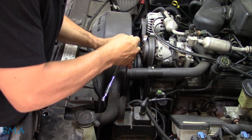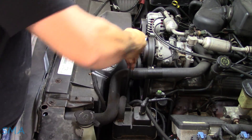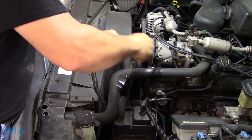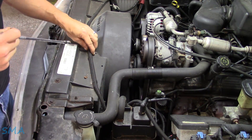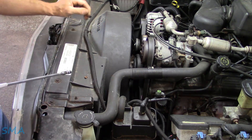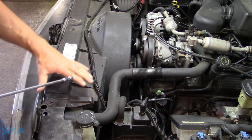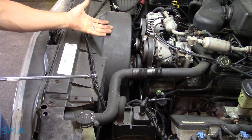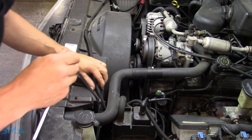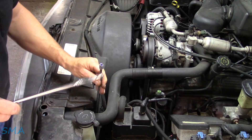We're going to see about getting this fan shroud off. The bolts are looking pretty crusty. I'm going to go through and get them all loose. We have two bolts down here on the side of the fan shroud, three across the top. We've got a battery cable here that goes over to the fuse box — we'll take that off. We'll take off the 5-7 bolts total and see if we can't pop that thing up out of here.